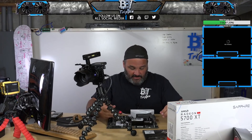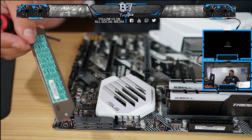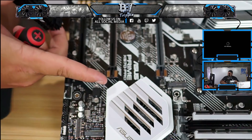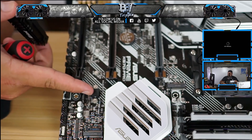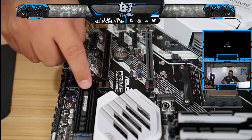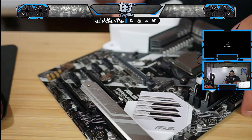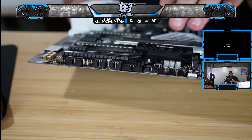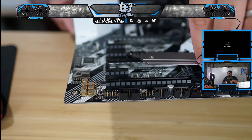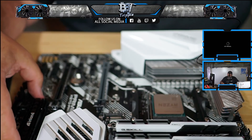There is a thermal pad underneath that cooler, and these are actually pretty long so I think they're made to work together. There's a bumper right here that's resting it flat — that's as far as it goes down, it does not push down like a normal M.2 slot. And I don't think this is going to fit — look how high that is, at least an inch off the board. They give you some pretty long screws but that is not going there.